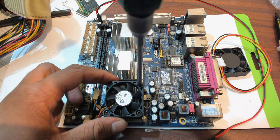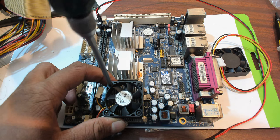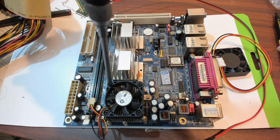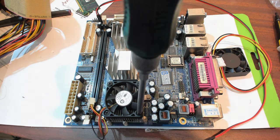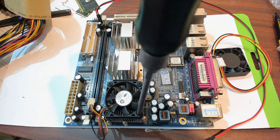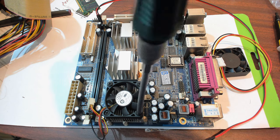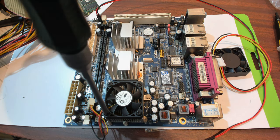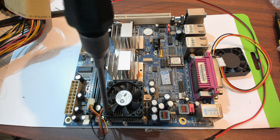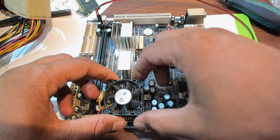So these secondhand units, depending on who you buy it from, they might get some refurbishment, but mine was a dusty old unit that had a blown cap. Some people got these units with just 256 megabytes of RAM. I was lucky enough to get double of that, and of course you can still buy the memory module. So DDR266, I think, is still available. That's DDR1, so it's super slow, but you can still buy them. However, sometimes you're just lucky enough and you get more.